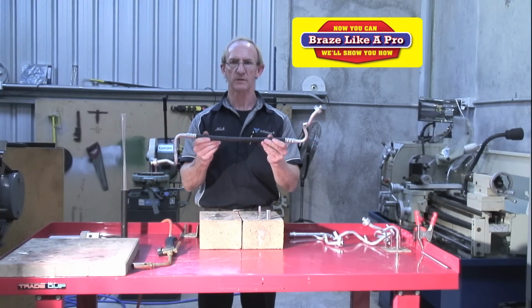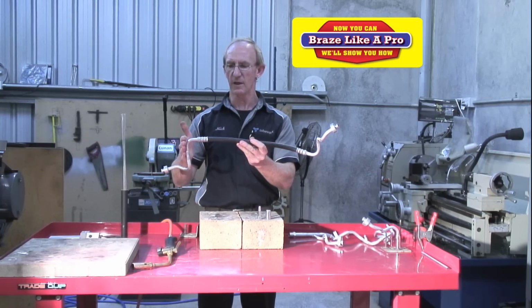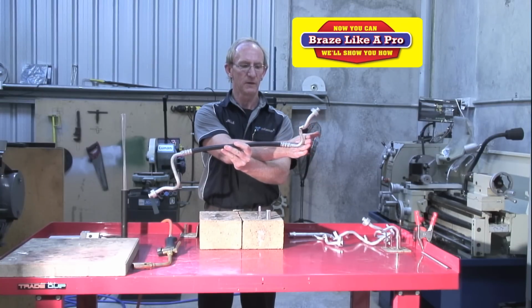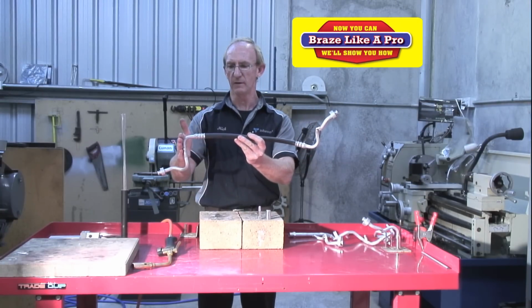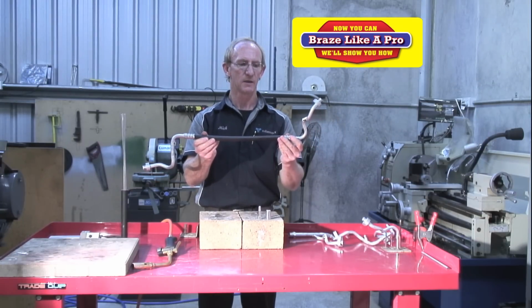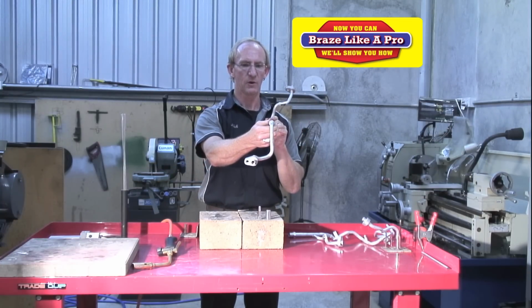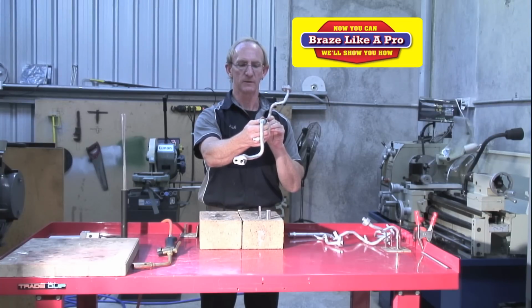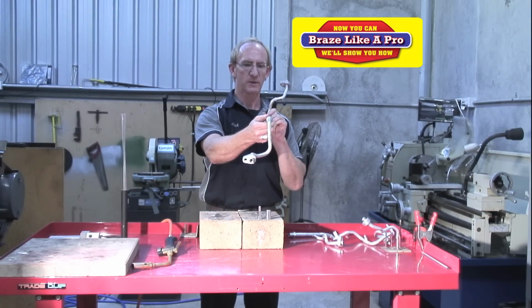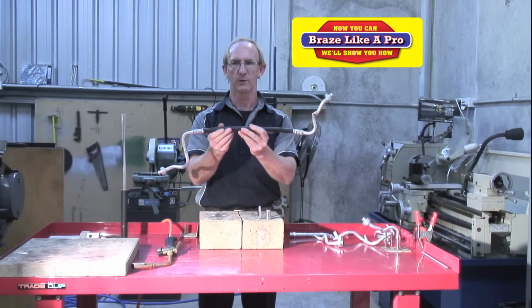To do this, we first must note 2 important steps. The first step is the overall length of the hose. This can be done from bend to bend. The second step, if the hose has any orientations, it is important to note the orientations before you part the ends. The end closest to me could be noted at 12 o'clock and the end furthest from me at 6 o'clock. Once these have been noted, we are clear to part the ends and start the welding process.